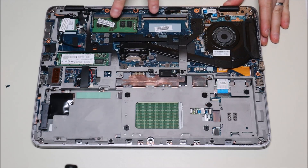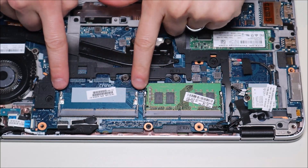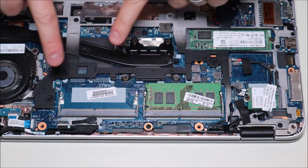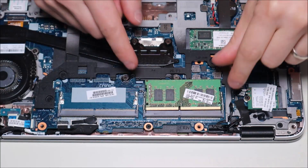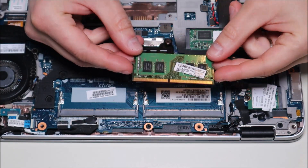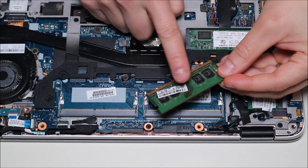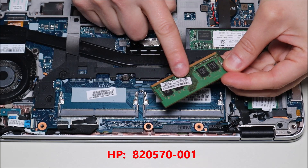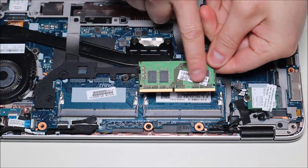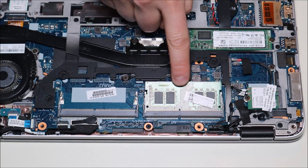There's your solid-state drive and there are your two RAM ports. We have one RAM port that has a RAM stick in it and one that's empty. There are two metal arms that are spring-loaded, and the way you release the RAM is by prying them apart from each other — the RAM stick pops up just like this. For those looking for an easy replacement, there's a convenient sticker with the HP part number: 820570-001. To put the RAM stick back in, you match up the long and short port, put it in flush, push down, and it snaps in on both sides.